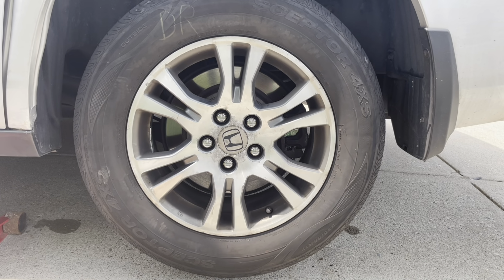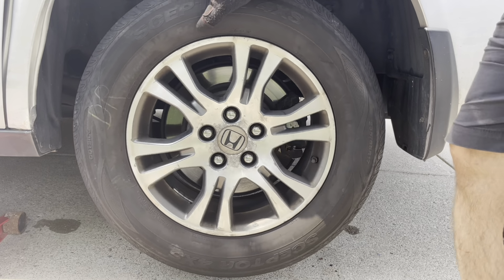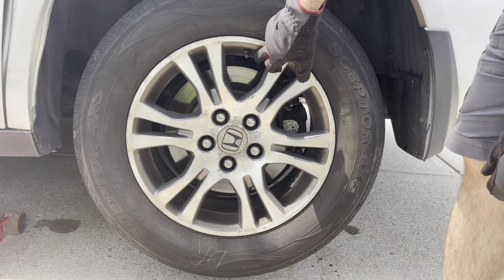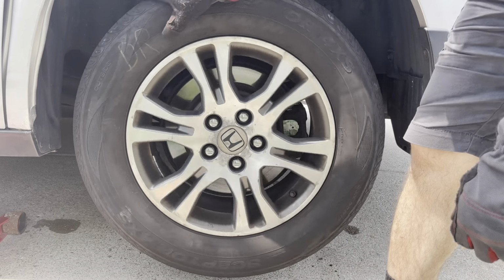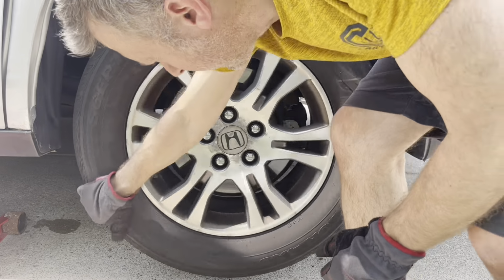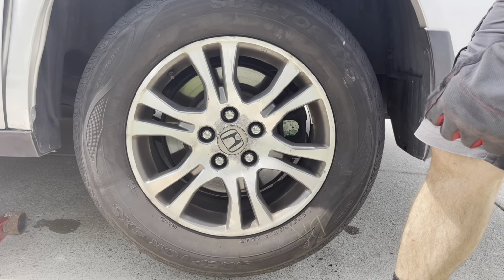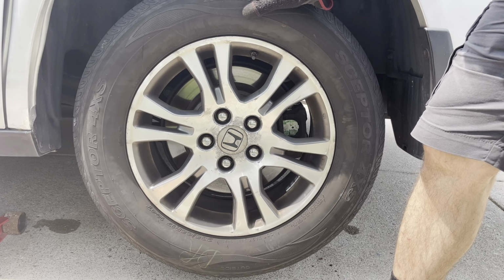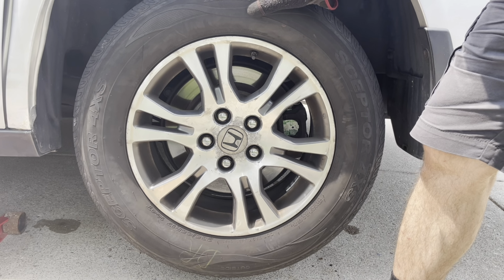So I finished mounting the wheel, and I usually test if anything is wrong, if it won't rotate that much. I mean, if the brakes are stuck or anything like that. So I locate the valve, and the wheel rotates this way when your car is running, right? I will give it a good spin. You have to put some effort. I release it here, and then I count how many times the valve rotates. It has to be between 2 and 3, and I have another video that I'm gonna show later. I'm gonna put it in the upper right corner.